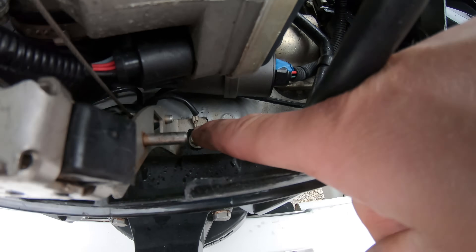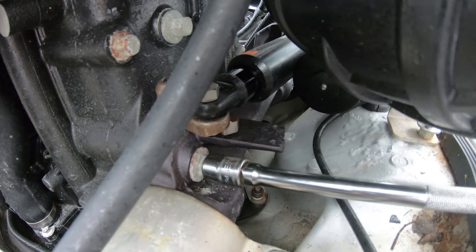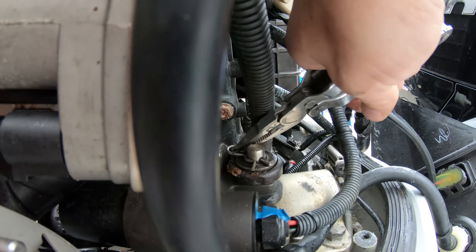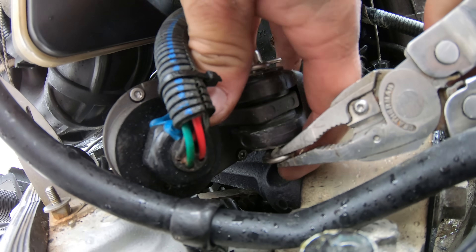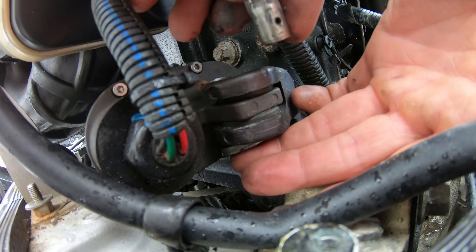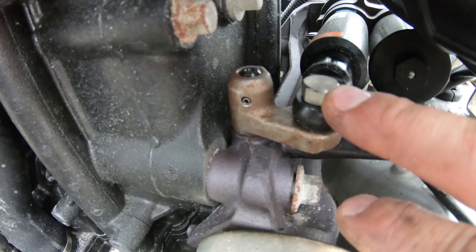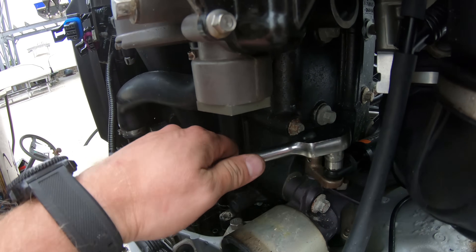Now on to the front side. Remove the 10mm nuts and bolts holding the two pieces on, then take out the two 12mm bolts under the shift actuator. Some guys leave the actuator hooked up, but if something is in the way we move it. Spin this pin around, then take your finger to catch the washer and remove the pin. Push up on the other pin and pull it out, then get the washer from the bottom. There is a 12mm bolt attaching the actuator to the shift crank — it is usually really tight. Just have the actuator disconnected, slide it in, and break the bolt free.